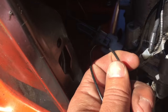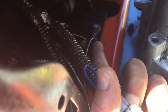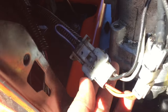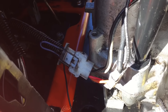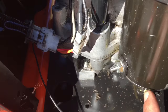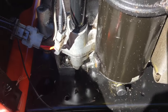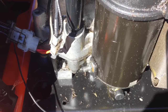One of the big problems we had was a couple of these wires — these are grounding lines — that just got torn right out of their socket. You can see where they're still attached back in here, still attached to the frame to ground the engine. Getting those tucked back into one of these connectors was not going to happen — I don't have the skill to do that. The other problem was she literally chewed through some of the wires, so the main power line which connects right here into the engine was broken. I could put some tape on it, but it's gonna get hot and melt, so I bought a new wiring harness and now we're putting it in.